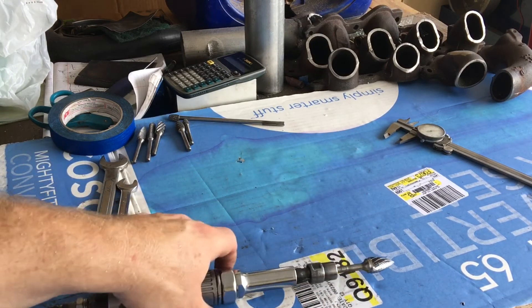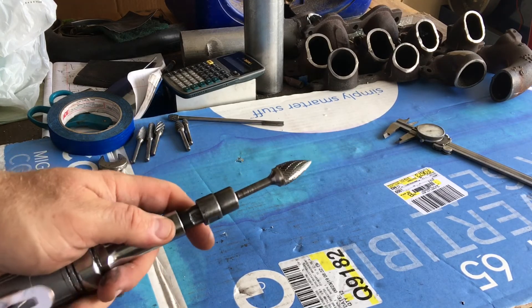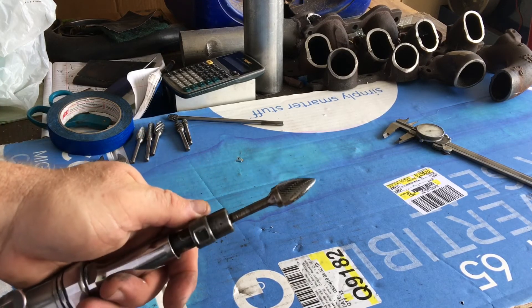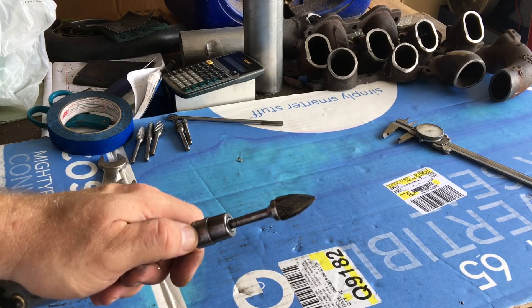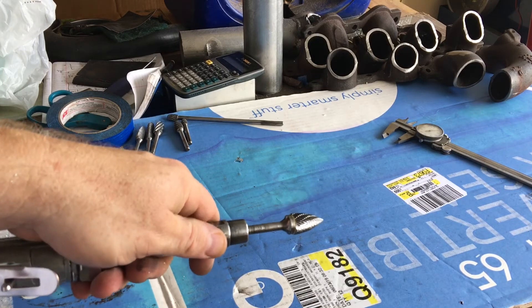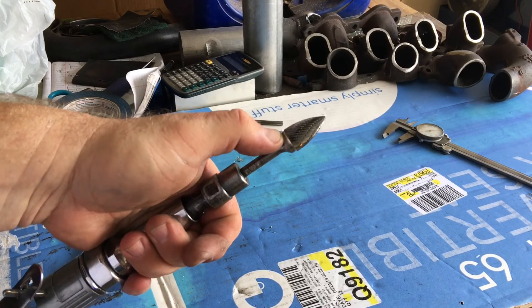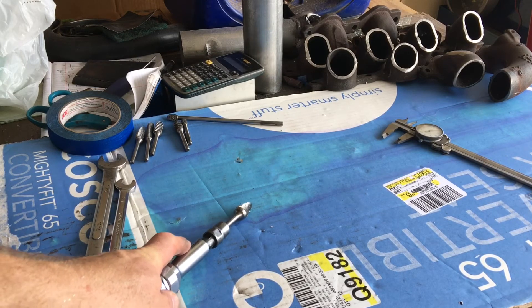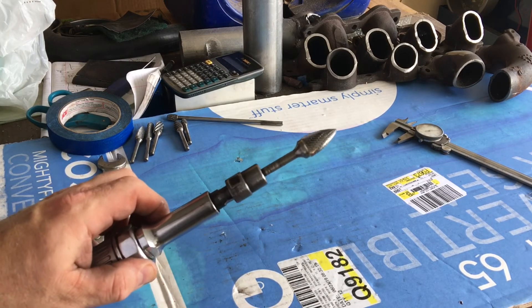I just wanted to give you a little eyeball shot of that 5/8ths double cut burr that I use when I'm doing the bulk material removal on that swirl ramp. It's a double cut — I don't know if you'd call this a Christmas tree, because I think the flame has to have the back part on it too. Basically I'm using the fat part of it to literally sit down right in that area and just remove the material where I want it removed. That way I get the angle and everything using this angle tool.